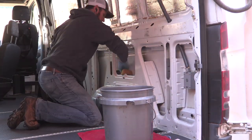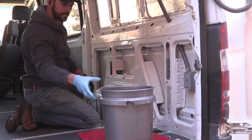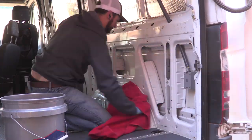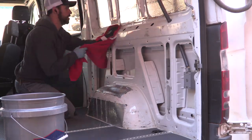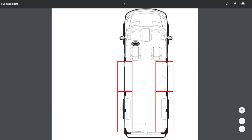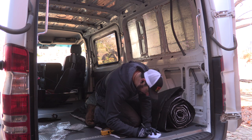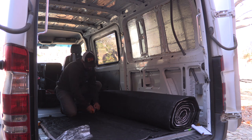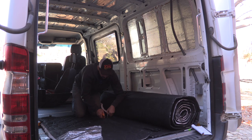After the walls were clean, I started installing the Thinsulate. Here's the process I went through: I broke the van up into sections — this is smart so you're not jumping around the van, and it helps if you need to break up your progress over a few days like I did. In each section, figure out your panels — these will be the separate pieces you cut and attach to the walls and ceiling. Make sure you measure your panels; I would measure a tad long so I could trim to a better fit if needed. Then cut your Thinsulate to fit your panel and figure out your scissors or cutting technique by playing around with a few approaches.